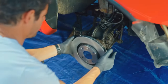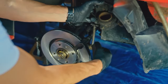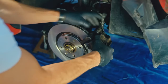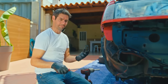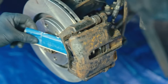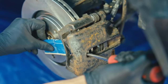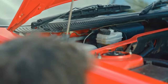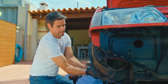What I'm gonna do is start by fitting the new discs, then loosely sticking one of the new pads into the caliper so that I can make the adjustment. I'm gonna use a screwdriver to lever against the disc and push that piston back, but of course I don't wanna damage our brand new brake disc. So a bit of folded up cardboard in there will allow me to lever against that and protect it. As I put some pressure on and push that piston back, it's pushing fluid back through the system, so you also have to keep an eye on the brake reservoir to make sure it's not overflowing - but it's fine. And there we go, job done.